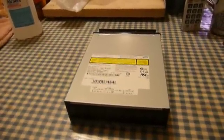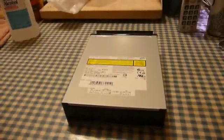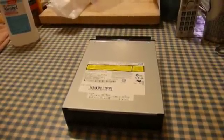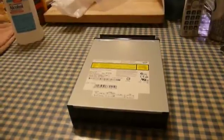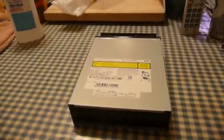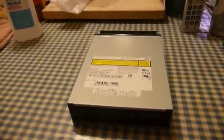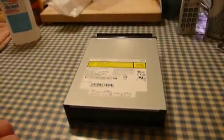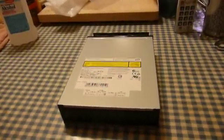So I knew something was up, because this thing was having trouble burning CDs, and it wouldn't burn DVDs, and it was even being a little fidgety about reading discs. And it's unlikely that both of the lasers in this thing would be bad at the same time, especially since it hasn't had near as much use as some of my LiteOn drives have had.